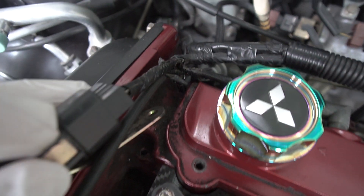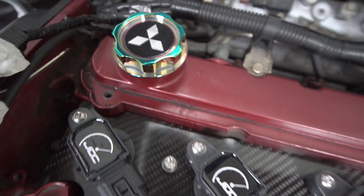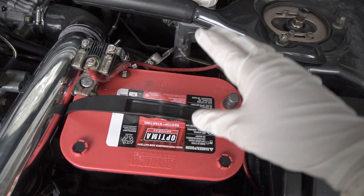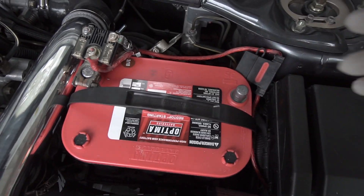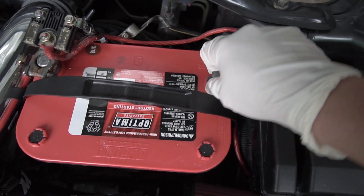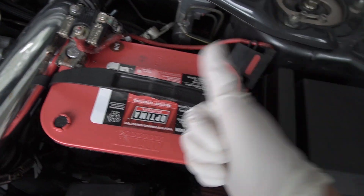I'm very glad that I'm going to be taking this valve cover off. The very first thing you want to do before you touch any electrical equipment in your car is disconnect the battery. In this case, I disconnected the negative terminal and you should be good.